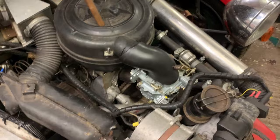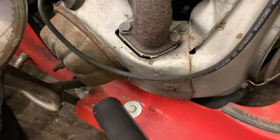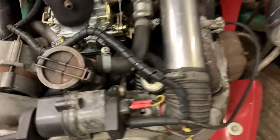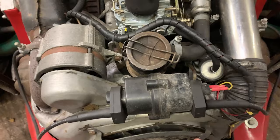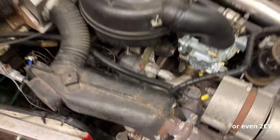It's going to need a service - it's been stood for three years. You've got the oil filler, plugs down there that'll probably need doing, and I'm going to check valve clearances. I've been recommended by Ian of Hubnut to get a spare coil because they get very hot and stop working. If you carry a spare one you can keep swapping them whilst the other cools down. Any tips for 2CV-based ownership are very welcome.